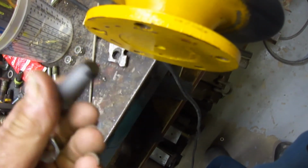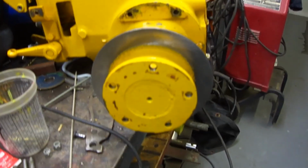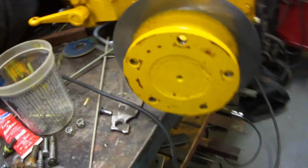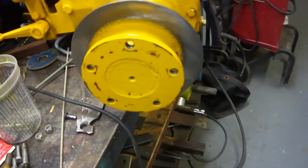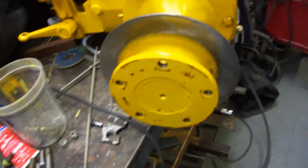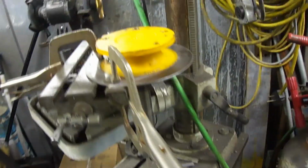And there's a lug nut there, so that's what I want to try to do. I want to try to make these studs with lug nuts rather than lug bolts. So that's what we're going to try to do. We're going to drill this out and tap it and see what happens. If it don't work, I'll just make me a bushing and step it back down to that bastard size again at 7/16.